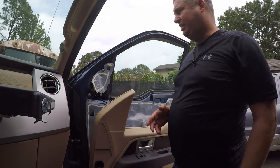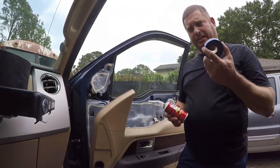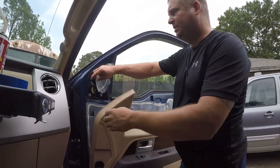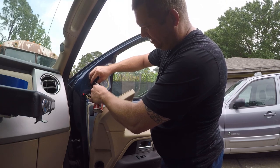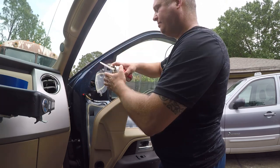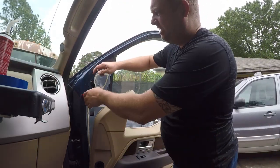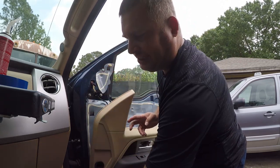With a big sigh of relief, it looks like that solved the problem. Now let me make it a permanent fix. I'm going to put some dielectric grease in there, then electrical tape, then friction tape, because I think water is able to get in here sometimes. Let's undo this and add some dielectric grease into this fitting. It doesn't take a whole lot — just there to keep water out. It's squeezing out the sides, which is what I want, because now I know water can't get in.